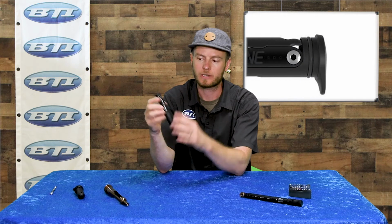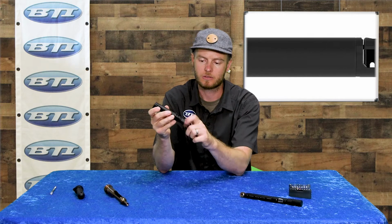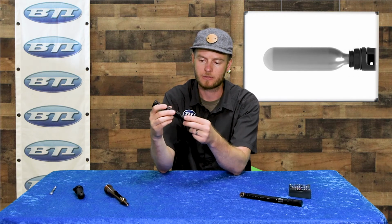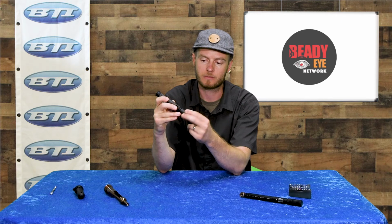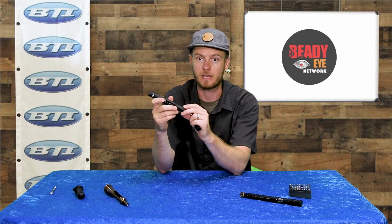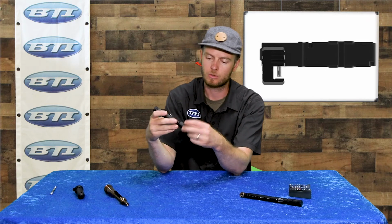First of all, this V2 tool, this is the tool and it kind of has a carrier all built in. The part of it is these two canisters at the bottom, so two removable canisters. You can even thread a CO2 cartridge right down here if you choose to remove those canisters, but you have the options of the two sizes without a CO2. They have some other really neat tools that can thread in here, like a tubeless plug jabber tool. So that can be covered over by the smaller canister, kept protected. And these canisters do a good job of keeping those little bacon strip rubber plugs moist and functioning longer as well. So pretty cool here.